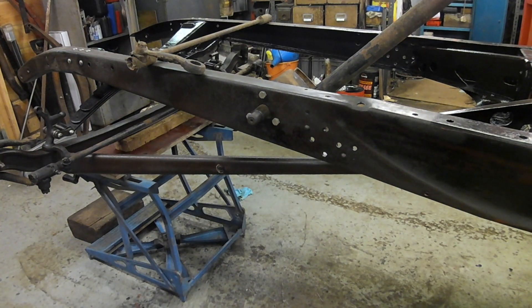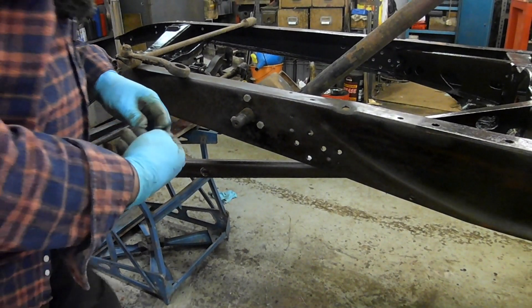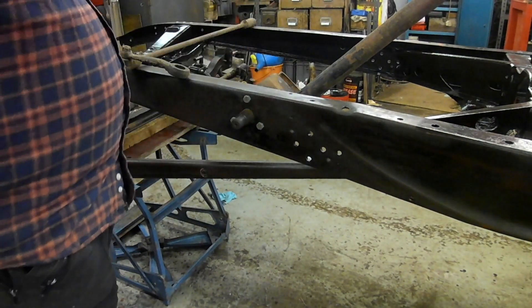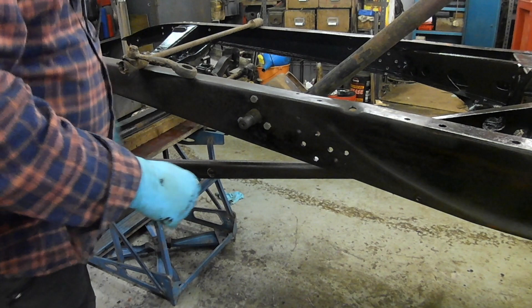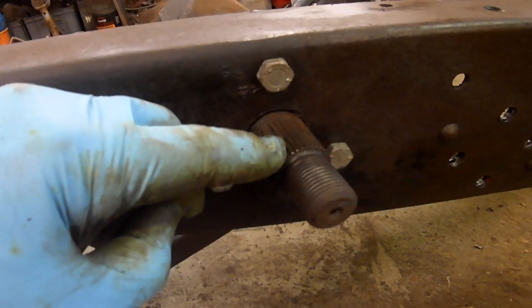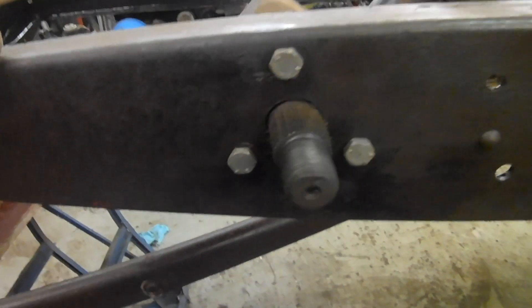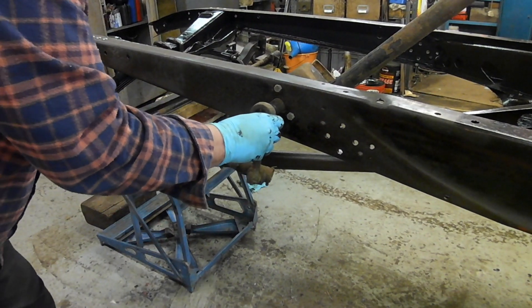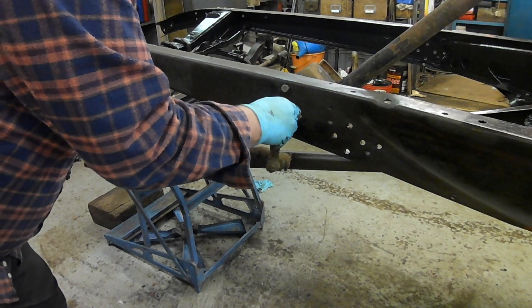The battery went and I'm not sure when. What I just did was scrape all the splines out of there, and I've wound it to roughly what I think is the straight-ahead position. There are two dead splines — like a gap in the splines — and basically they're like the four corners of a square. When you look on this, you can see the dead areas are in that relationship, so that is sticking straight down and should go on there like that.